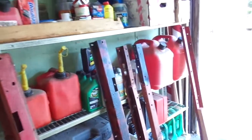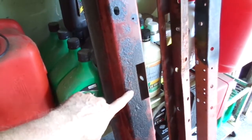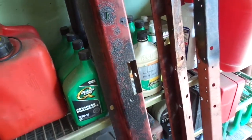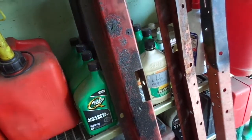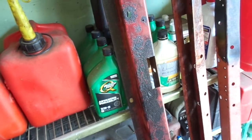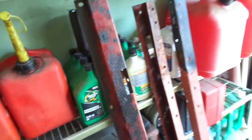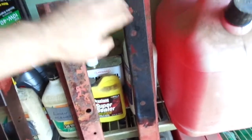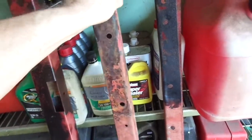As I've had these apart — see how that looks kind of shiny and jet black there? There's some stuff I've got called Extend Rust Treatment that takes the surface rust and just locks it up to where it's basically ready to paint over. If you want it to look prettier you can sand it down and then put the paint over it, but for a utility trailer I'm not going to bother to make it cosmetically perfect. Here are the two bent pieces for comparison — this one I did the rust treatment, this one I haven't done yet.